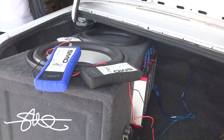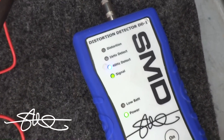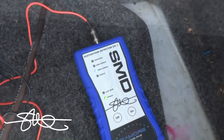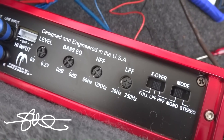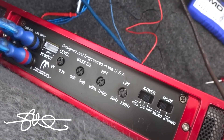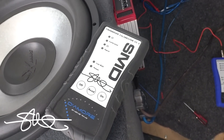Alright let's set these gains properly and match these amps together. That's just ridiculous. Alright the gains are set - now it's time to set the crossovers. As you can see it goes from 30 hertz to 250. No way on this earth anybody's ever going to be able to hit 80 like I'm trying to hit right now. But let's say you were lucky enough to hit 85 or 88 or something real close - there's no way you're going to be able to match that crossover to this one perfectly. So we're going to go ahead and use the SMD CC1 to match these things up, and he's going to be ready to ride.